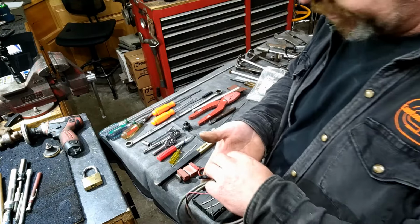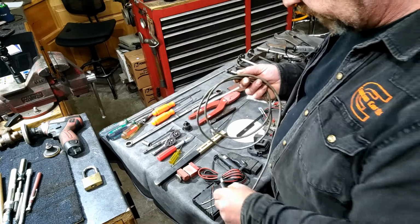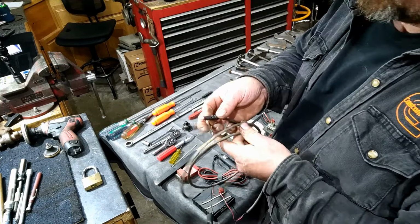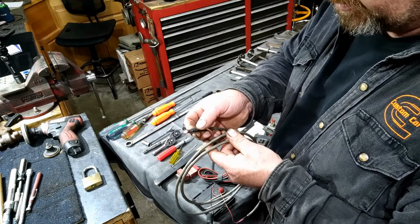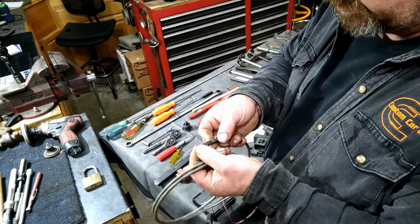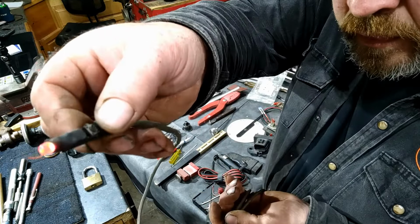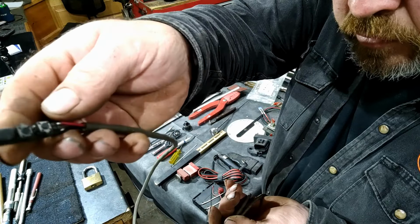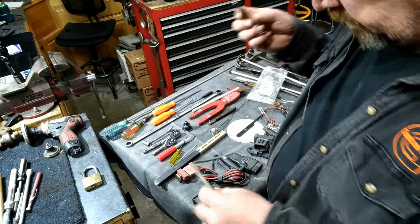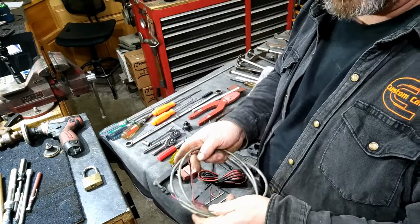So I bought that original power probe. And I'm like, well, I can make one of those. So I made this one. And it just is supposed to be orange. And then that's power. And it sends power out to this little needle. And then that's ground. It sends ground out. So there's just 2 little switches with a circuit board. I don't use it very much, but once in a while it comes in handy.